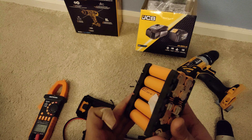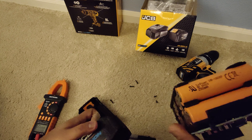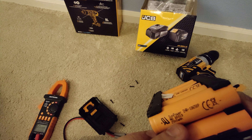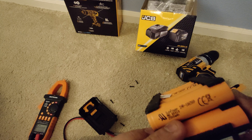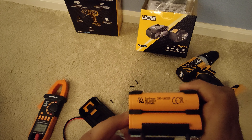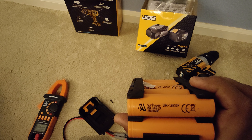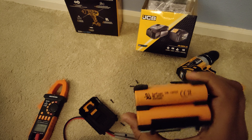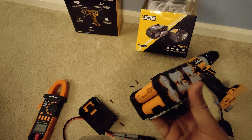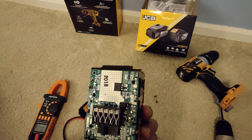Like I thought, there are five cells in a pair, so a total of ten cells — five amps total. Each battery is 2500 milliamp. The brand name looks like it's called SunPower 18650 lithium-ion cell. The model is SunPower MH60919, 2500 milliamp. Two in a pair makes five amps, total ten cells. Each cell is charged at about 4 volts, and the maximum charge is 4.2 volts.